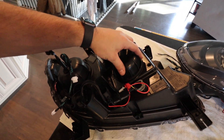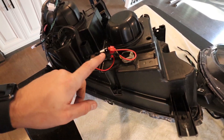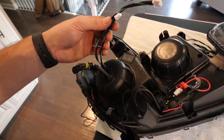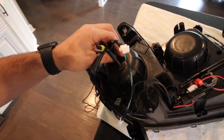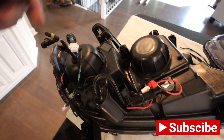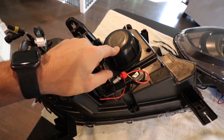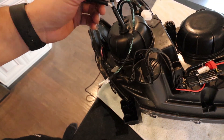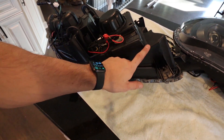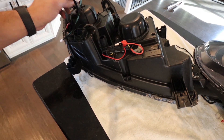Dust caps fitted on nicely. I sealed my resistors from when I had the switchbacks — I'm going to leave the resistor there because I probably need it with the halos. These are both the feeds for the low and high beam switchback halos. I ran them through one grommet on one side — a little cleaner and easier to deal with. I only drilled holes in one side; I'd rather drill holes in something easily replaceable than something I can't fix after the fact. Low beam HID wiring comes out through the same type of grommet. That'll feed to a ballast — I'm going to mount the ballast right underneath here, since there's plenty of room down there.